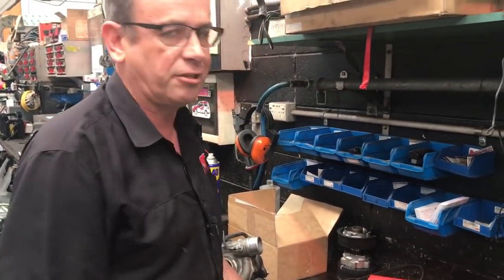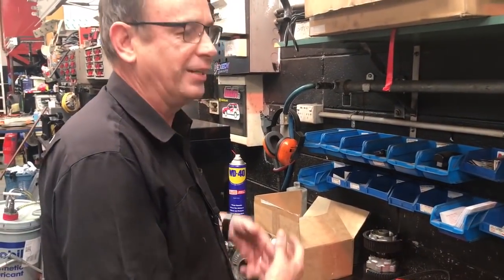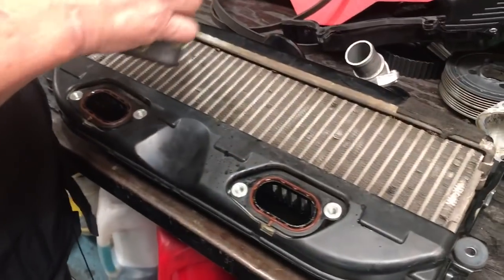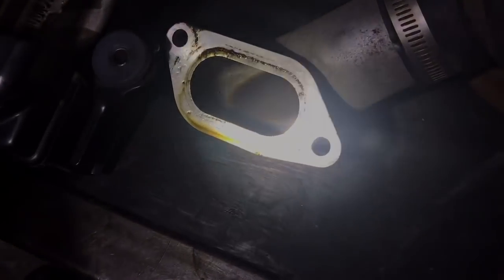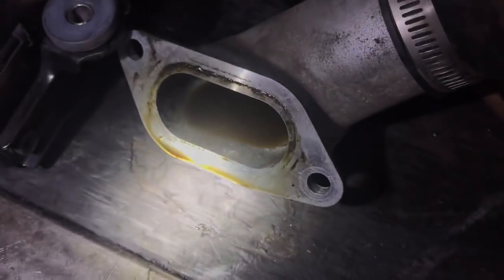The intercooler acts like a ginormous sieve — it stops parts going through, but some go through and some get stuck in the intercooler. I just want to show you what you need to be aware of. Inside here it's actually full of chemical to try and clean it, and you can see it's glistening. We'll drain all that out in a sec.